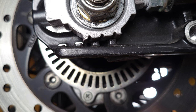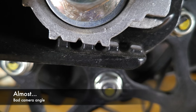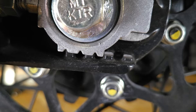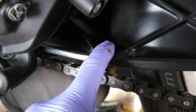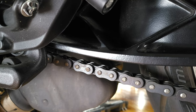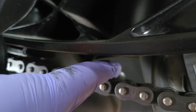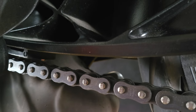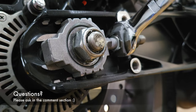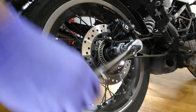I finally got it dialed in. Here we have that indentation — push it up. That looks like a good 5 to 7 millimeters of travel. The chain is not even touching — that's about 7 millimeters. I went ahead and measured this with my Vernier calipers. You can use measuring tape or whatever you have laying around. Now I'll just go ahead and tighten all the nuts back up and you should be good to go. I have the 17 millimeter on the other side and here I have the 22 millimeter, and I'm just gonna go ahead and gently start.